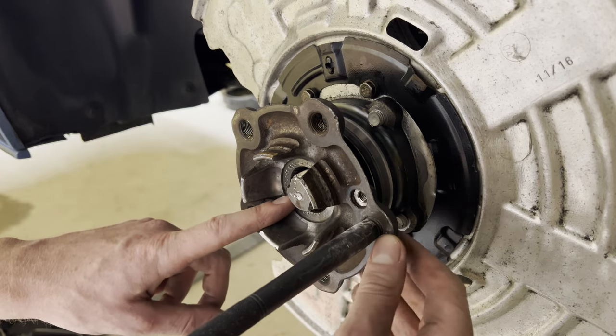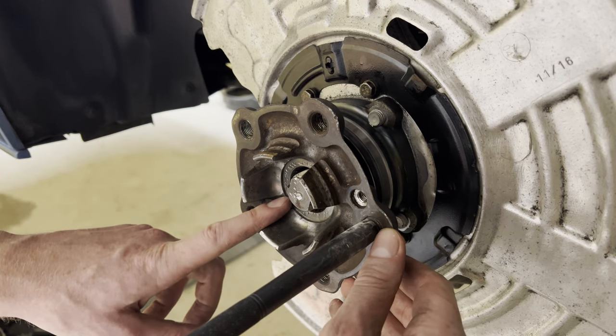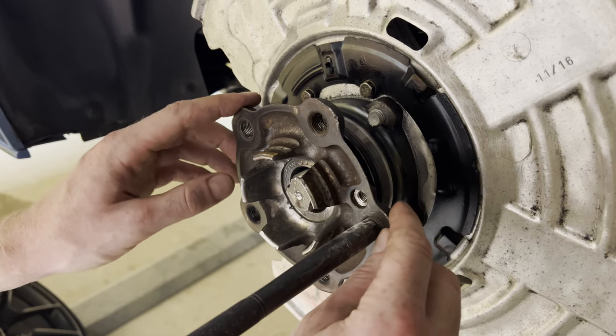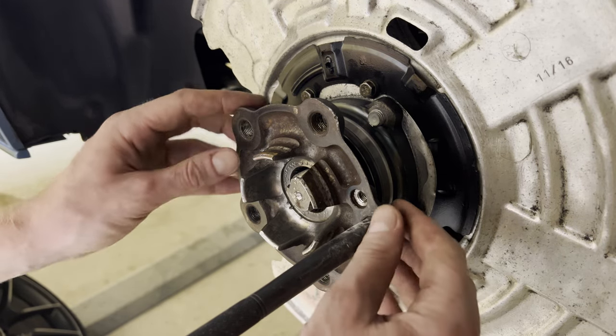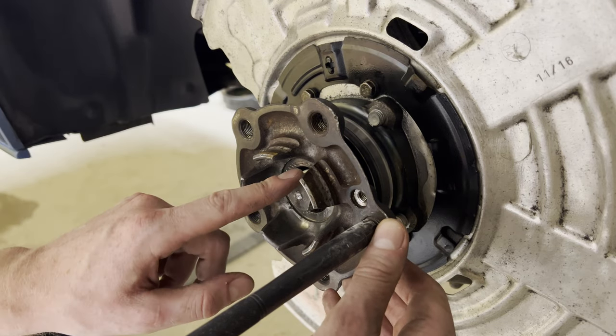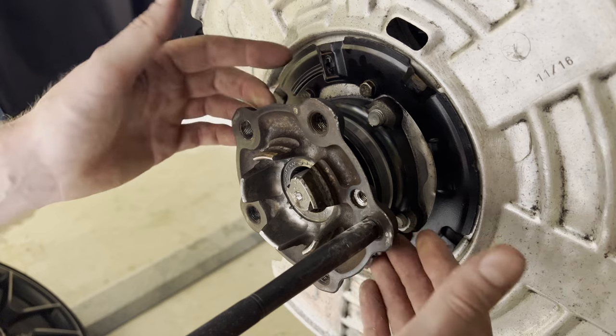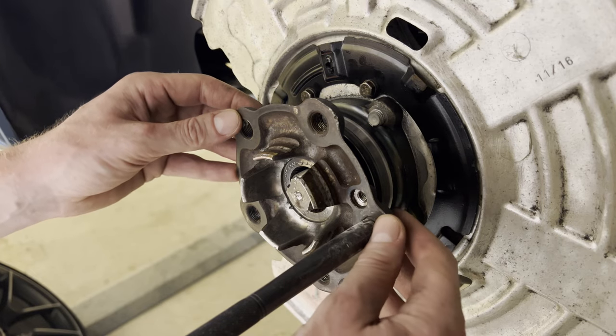I believe hammering in the CV axle through the hub like I did is actually damaging the bearings. Before I started hammering, although very slightly and with a piece of wood, there was no play at all, as I've just showed you. So I believe the eccentric force of hammering in the CV axle stresses the bearings to a point that they start to become, well, loose. I'm afraid it's just me messing up here.